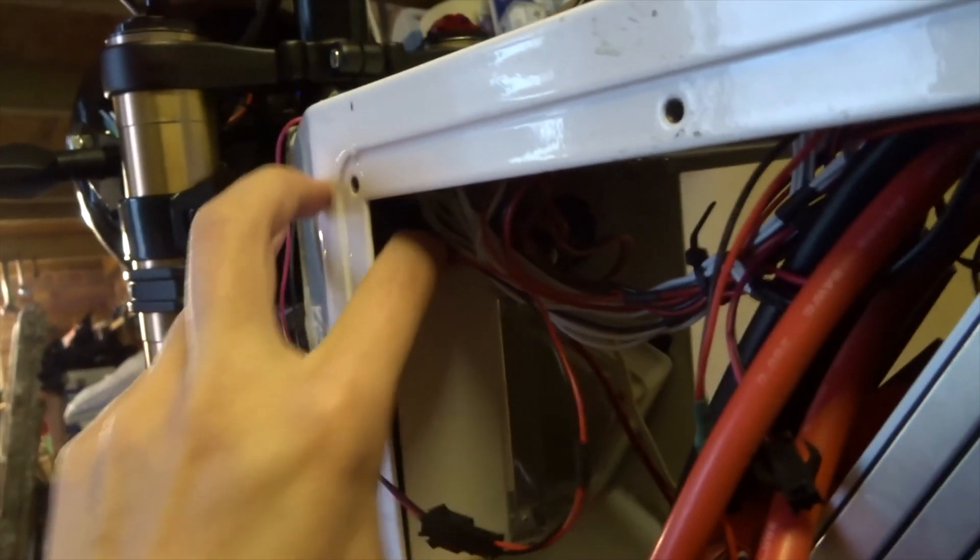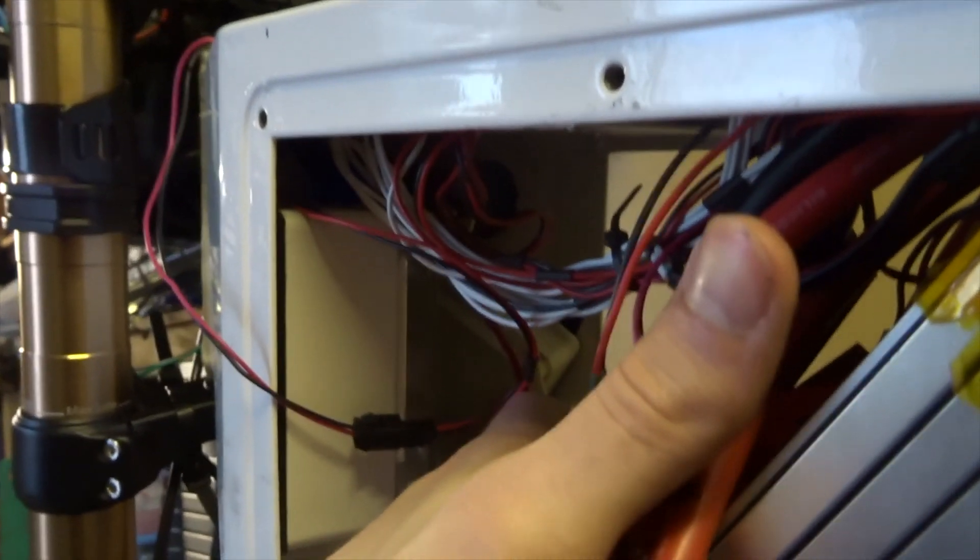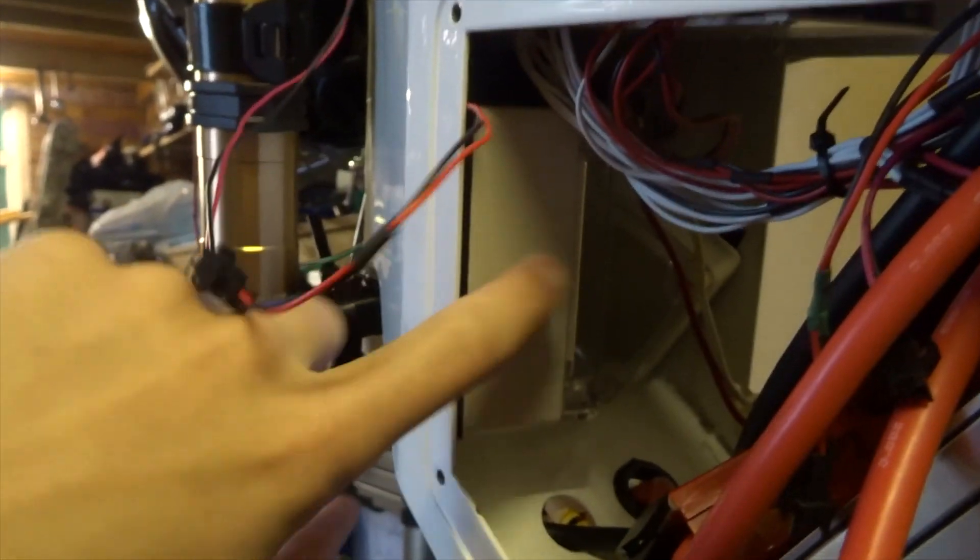This means I'm going to have to put them in in a particular order: that one first, then this one. We've also got the main power wire for the BMS just up here which will run over the top. That's the second box mounted pretty securely. I'm going to take them both out and start wiring up the 12-volt one - I'm going to make this one over here the 12-volt box, and make the upright one the 5-volt and Arduino one.